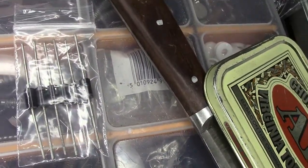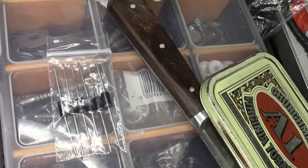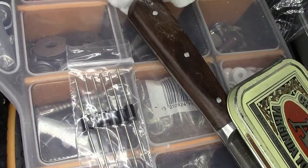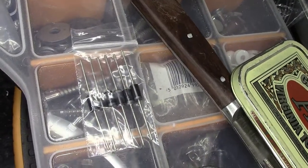These are 40 volt 5 amp. I'm putting 13 volts, but maybe 14 volts with the lithium ion. I think you're supposed to double the voltage to make sure they're correct, so 2 times 14 is 28, so they're well within spec. 5 amps. I'm only running a 1 metre long strip light, which only takes half an amp.